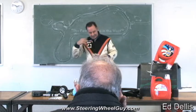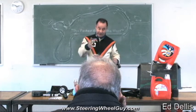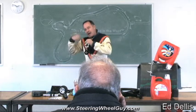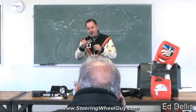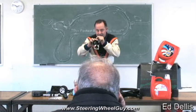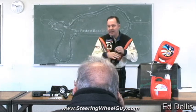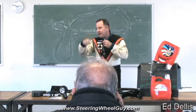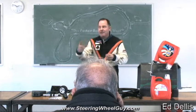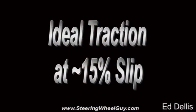Forward. If you don't squeeze on the brake pedal and you tromp the brakes because you've gone in a little too deep — you've got this adrenaline dump, you're freaking out and you jump on the brakes — what's going to happen is that tire is going to start sliding on the ground. We've already talked about it losing 30%. They jump up to a maximum point, let's call that a 10, and then come back to a 7. So once that tire is sliding, it can only produce 70% of the force it would if you kept the tires rolling, which is why we have ABS. The anti-lock brake system tries to keep the tires in unity with the ground at about 15% slip, which is technically where the tire is at its happiest.